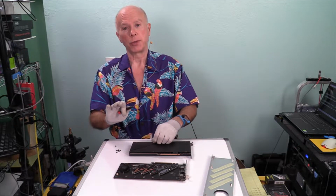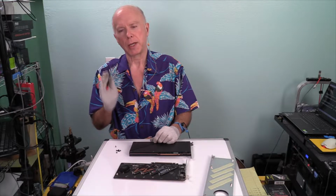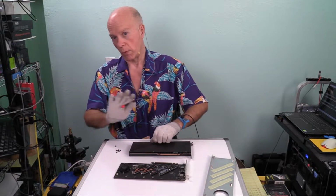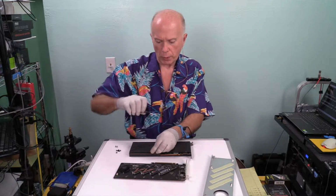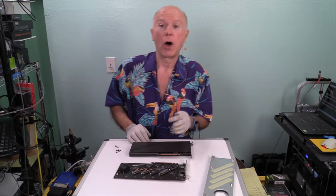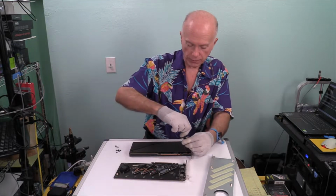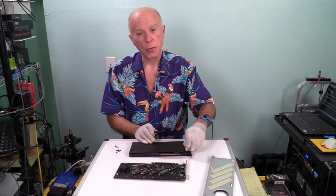Unless you want to do PCI Express 3.0 on the X299 chipset on an Asus workstation class motherboard that would have a PLX chip to give you the lanes. But we're not doing that. PCI Express 4. And we have to think about PCI Express 5 is coming. So we're at the point now where we have access to PCI Express 4.0, let's call it 3rd generation drives, that are good for about 7,100 to 7,200 megabytes on the read and almost 7,000 megabytes on the write. That's wicked. But that's not these drives. These are first and second generation drives, PCI Express 4.0. But if we get a chance to test one, we'll look forward to it.